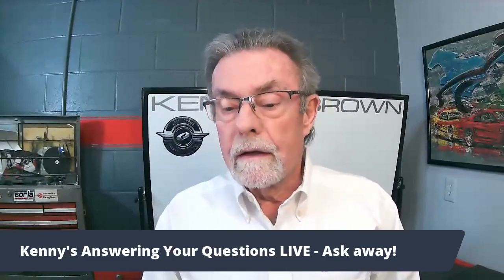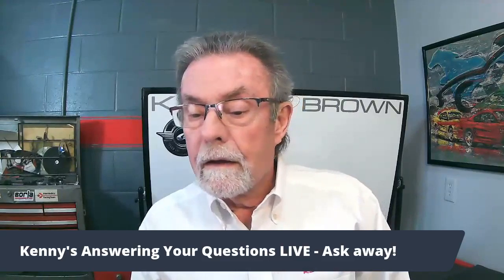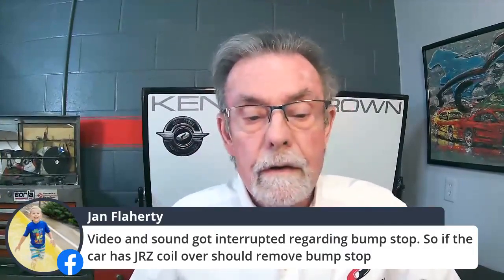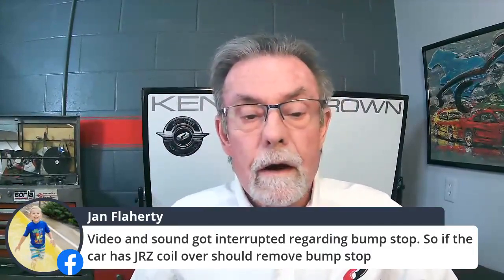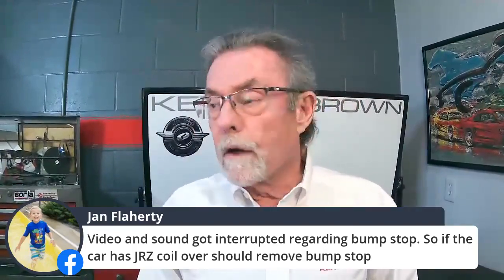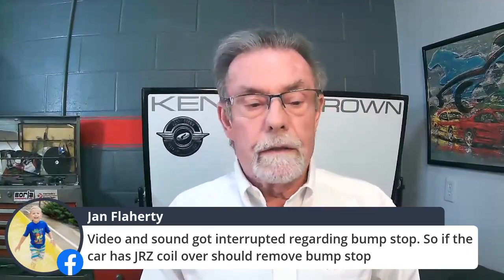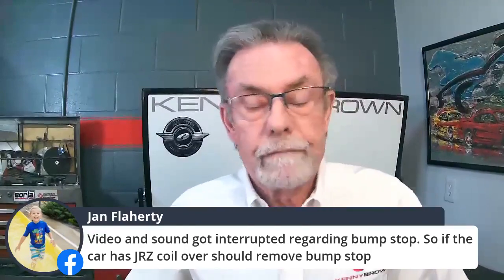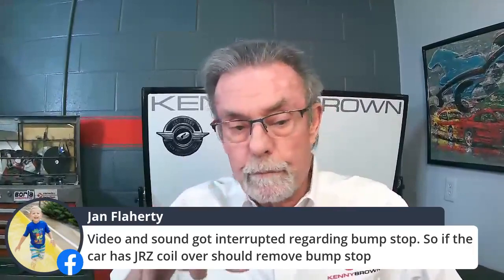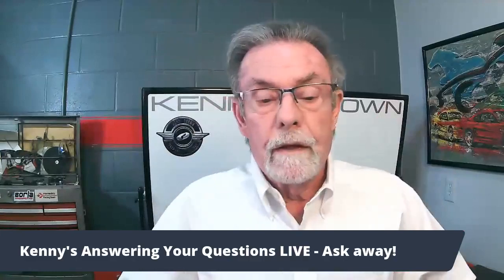Looks like Jim Flattery says the video and sound gets interrupted regarding the bump stop. He says, if the car has a JRZ coilover, should he remove the bump stop? Well, yeah, throw it away. Absolutely, because you're running plenty of spring right back there, but just in case, you don't want it to get on there. And if you're crafty, you could even cut that little part that sticks out, because that's the next thing you would hit if you hit a really big bump.